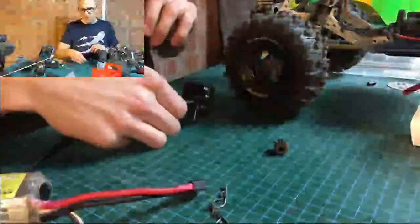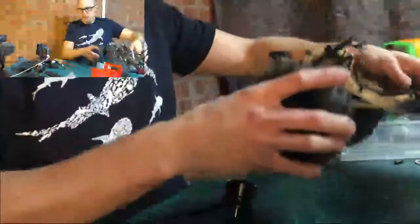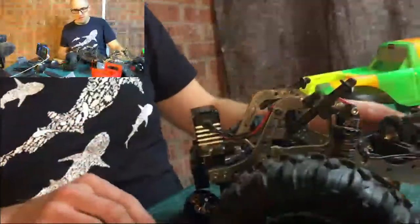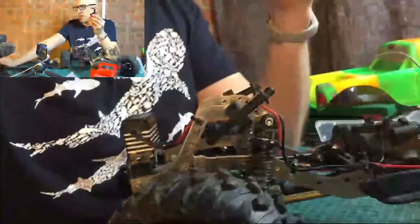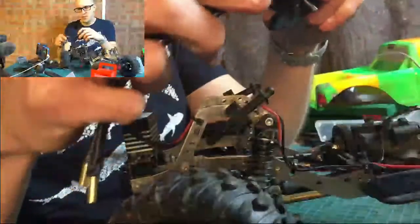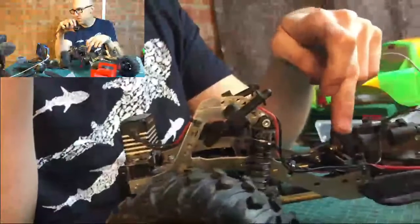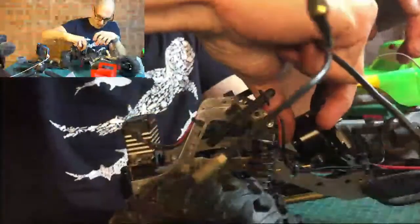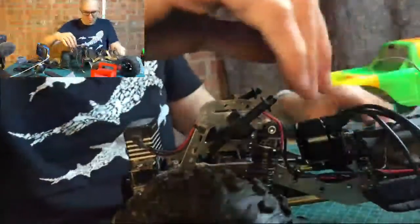And now I guess we'll get it installed. I just realised this camera's on a short lead. Right, there we go. Not the hardest thing in the world. You look up the right pinion size and everything else and just bob it on. So this is going to use a 14-tooth pinion. For the 45-tooth spur, Traxxas have said put it in hole F, which looks about right.